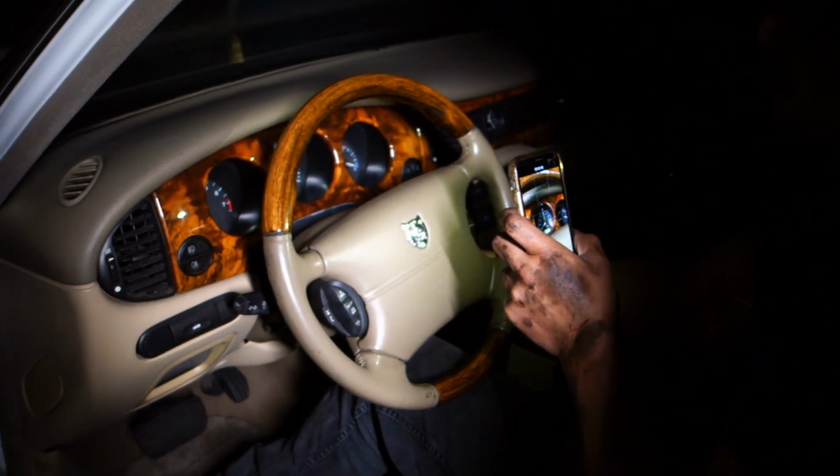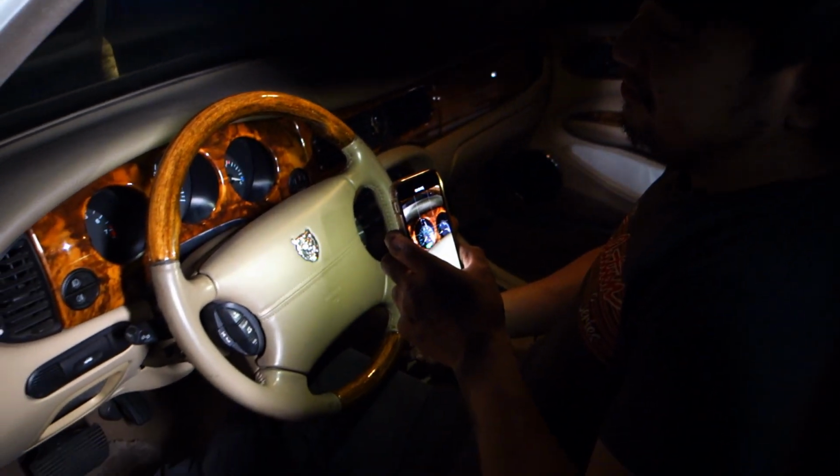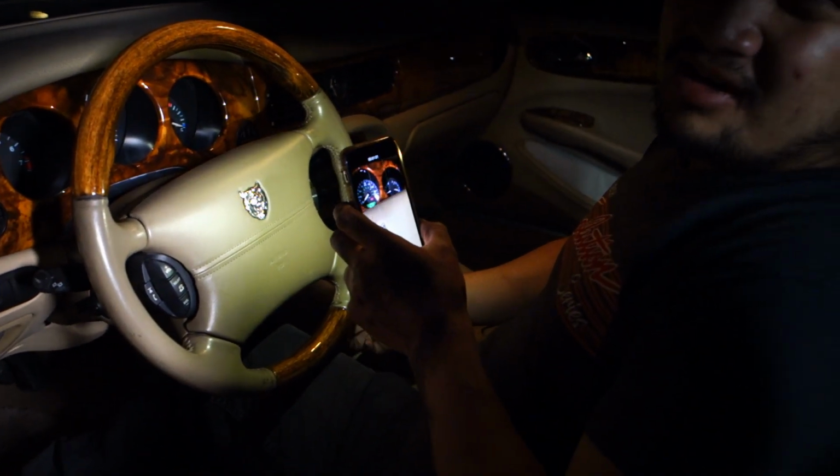Alright, I think this pretty much concludes it. If you want to buy a Jaguar on the cheap, you want to replace the fuel pump, you don't have the $389 Jaguar is asking for the part. Go ahead and order an E2226 Ford fuel pump. It fits perfectly fine in the fuel tank. The car works perfectly fine.